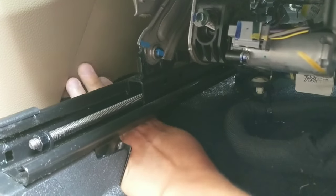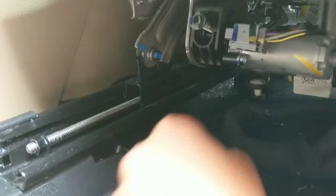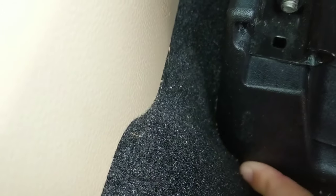Obviously you want to get down low. A lot of times with seats, if you pull the seat back, that gives you access right here — you can see I can access all the way in here. There's a lot of dirt and debris in these tight spaces and your vacuum is not going to be able to get to them. What I'll do is use compressed air to blow it out, or if you don't have compressed air, use the brush to agitate it. And you can see we got a lot of this stuff that was down here, then just vacuum that up.